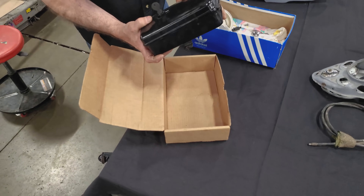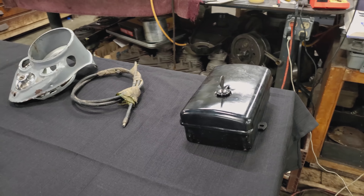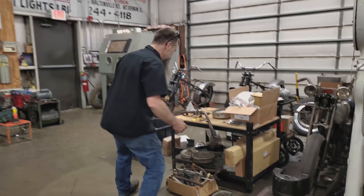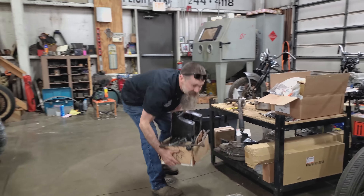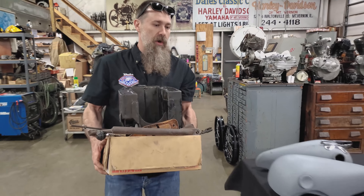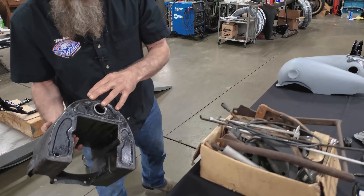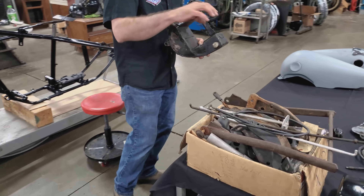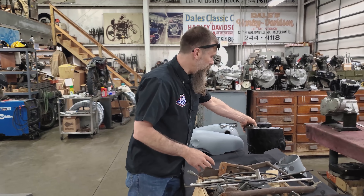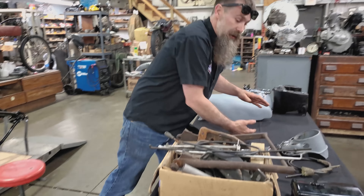1936 to '39 Harley Davidson toolbox. Joe had been collecting parts for this project for probably 30 years. What he set aside was the best of the best, and really excited to be putting all of this on the motorcycle. Now moving on — 1937, one-year-only oil tank. It's got the embossed top with the feed line down on the bottom. Normally you've got the feed line in the back and the drain plug on the bottom, but '37 was actually the only year that they put it all right in the same spot — works off a banjo bolt. Embossed top tank needs a little bit of restoration, but it's really incredibly nice and in darn good shape, straight as an arrow.